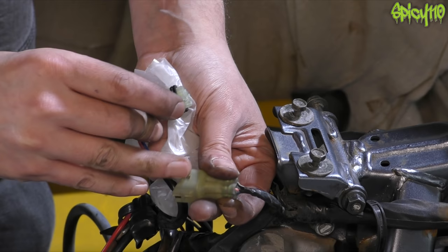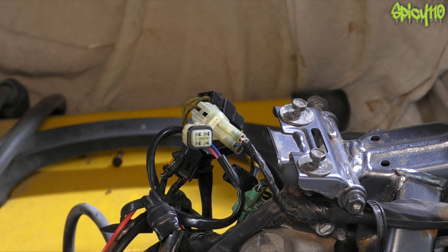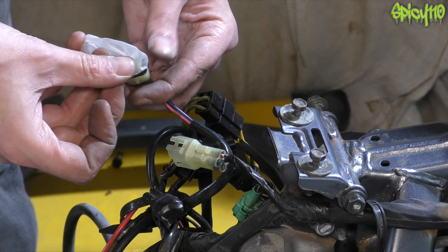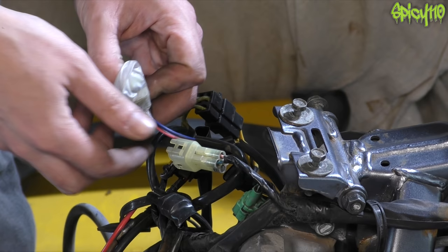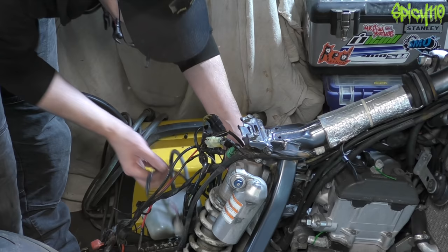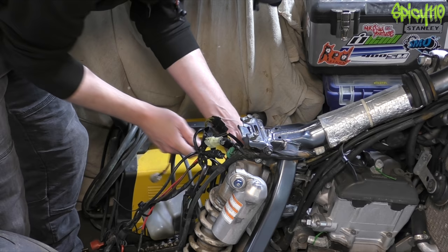I just spent about 10 minutes arguing with this connector. It's got a clip on this side, top, and this side - this one's easy to detach, but these ones are more permanent. I was very carefully trying to get all three sides off at the same time and each time you got one side off, the other side would clip back in. It's got a water seal - a little silicon gasket in there - so to make sure that doesn't get lost or damaged I'm going to put a glove end over it. I've just removed a load of the stock zip ties - the reusable ones. That one I've just disconnected is going to stay on the bike because it's a pickup off the bottom of the engine and I'm not going to remove that sensor unnecessarily.